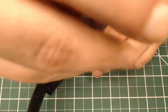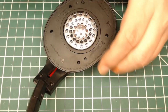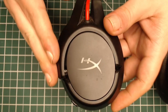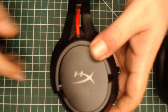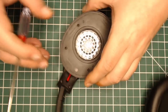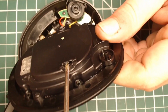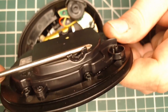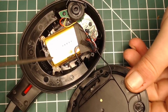What happens if you don't do cable management inside with the 10mm thick battery? The hinge will be off because there's a wire going through that hinge — that's where your main wire loom comes in, through that hinge — and it's sitting on top of the battery. With the stock 1500 battery, the loom goes straight across over top of the battery, no problem. With a 10mm thick battery in there, it hits the side of the battery and pushes upwards, contacting the hinge on the top plate. The hinges rest and pivot in the speaker shell — they're pretty thin, so be careful with them.